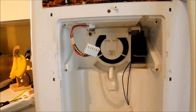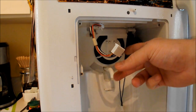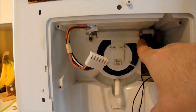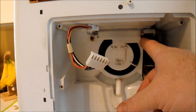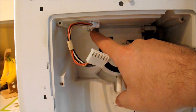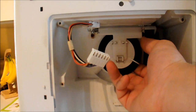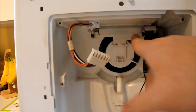That's what needs to be replaced. I've unscrewed the solenoid but because it's rusted, it's connected to this flap. So I'm going to remove the flap as well by unscrewing these two screws — this one right here and this one right here. There are metal tabs attached to both of those and a spring right here. Be really careful when taking this off — keep track of the metal tabs and the spring, which will spring off. Hold it with your finger. The spring is what holds the flap to the door and makes it seal. If the spring's gone, the flap will just hang there, your freezer won't seal properly, and bad things will happen.